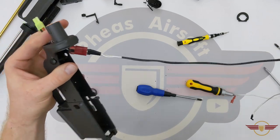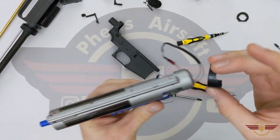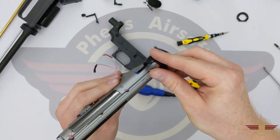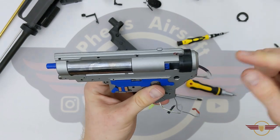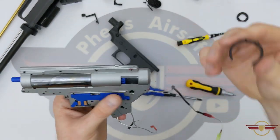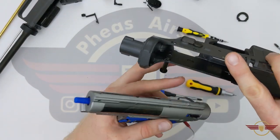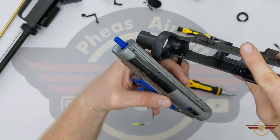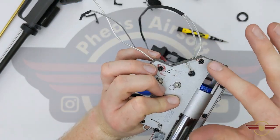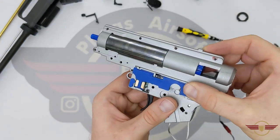So I finally got it out in the end, took a little bit. So what I needed to do was that clip was sat on the back of the gearbox, like that. And I got that far enough forward and moved it forward so I could literally just unclip that. That freed it up. Then what I realized is, as I was moving the gearbox, this back pin was moving a little bit. So the minute that I pulled tighter on this to pull it out as far as possible, and you can see here the marking, it instantly just released it after that. So I was into the gearbox quite happily.